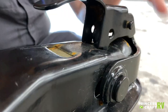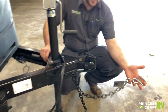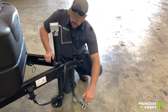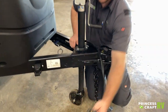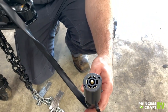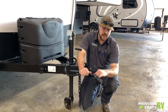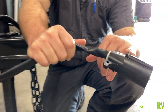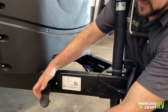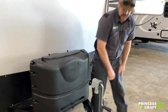Make sure this ear — there's one on each side — falls down into that slot all the way. That ensures you're coupled onto the ball correctly. To finish the hookup we've got our safety chains, which crisscross and connect to the receiver hitch on the tow vehicle, and our standard seven-way trailer plug, which runs all your brakes, lights, and turn signals. There's a little ear on top that faces the lid of your seven-way to help lock it in, and when not in use it stores right here on the A-frame.